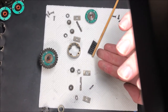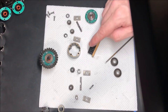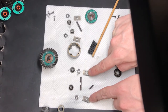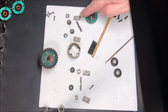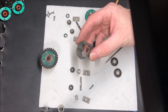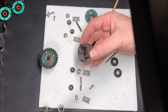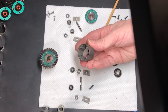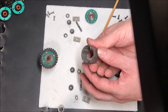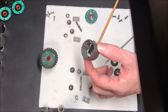Looking at two of the plates: one was on the bottom side, closer to the cap, and this side was on the upper side, closer to the ring gear. The bottom one is showing more wear — not sure why. Inside you can see there's some contact, but the stock case also experiences the same thing. There's a little bit of wear at the bottom from the plate moving, with a dot in the center.